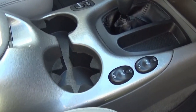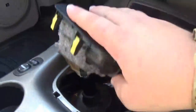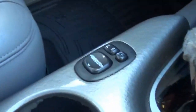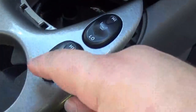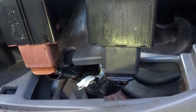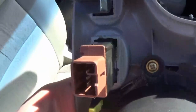Starting with these front cup holders — no tools are required, everything just clicks. Pull the boot up and grab this firmly, pull up and the whole unit should come right out. You will have to disconnect the harness clip for the mirror selector and for the heated seats. Look underneath on the back side for a little tab to depress to unlock the connector.